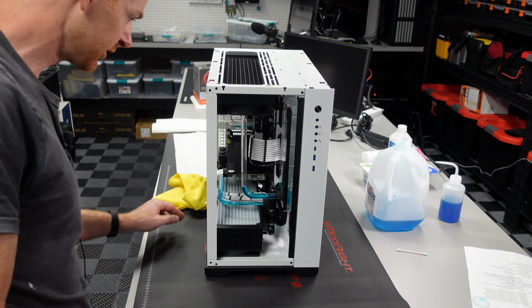Run it again. So here's a quick shot of the power supply setup. Basically what we have over here is a power supply. We have a little jumper that goes on the motherboard connector, which allows us to run that power supply while it's not connected to a motherboard itself. And then we just took the Molex connector and we plugged it into the pump on the machine here. So this will allow us to run this pump while the rest of the computer is powered off. And that way, if there's a leak or any problems, then we're not gonna have electricity flowing through the components and potentially damage or fry them.